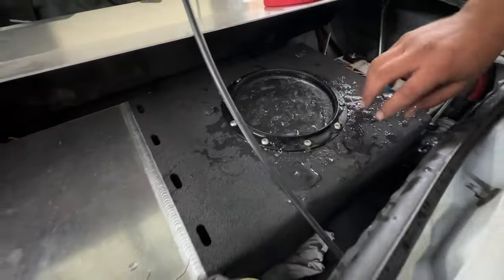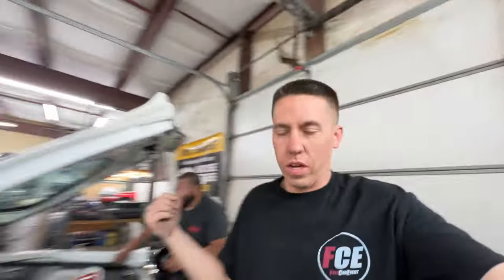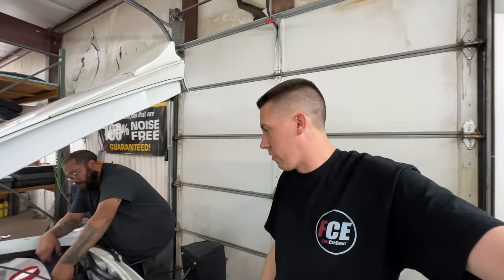AJ just filled it up with ice — we're stocked up. We're going to throw two more pounds on the dome, so five on the gate. With three on the gate it made almost eight pounds of boost; with five on the gate it should make about 10. Let's see what this thing makes on about 10 pounds of boost. I want to make sure it's got all the ice — it's only going to help. Maybe one more good pull and then figure out where we're at.